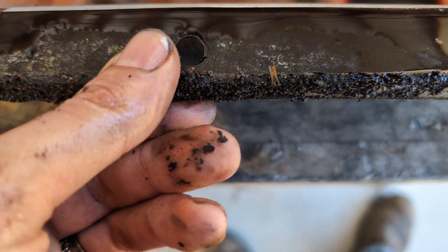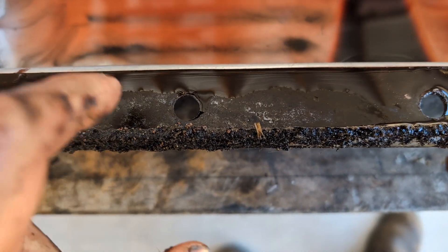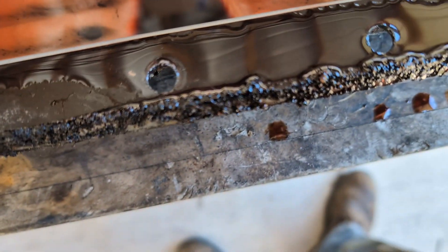I'll clean this up. We're going to switch from a cork gasket, which is what this is, to a rubber one. For the here and now, I'll clean all this up, wipe the magnet clean, get the pan clean, and then I'm actually going to stick it back on there temporarily because that protects the insides of the transmission from getting dirty. Then I'll continue on with getting the transmission disconnected.